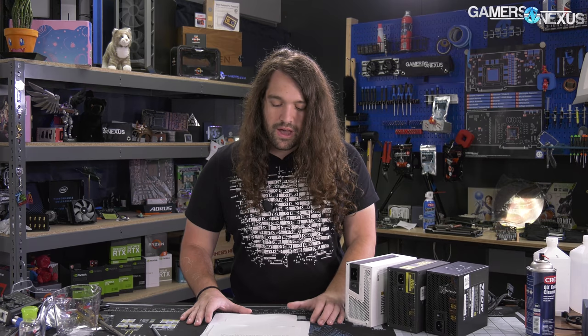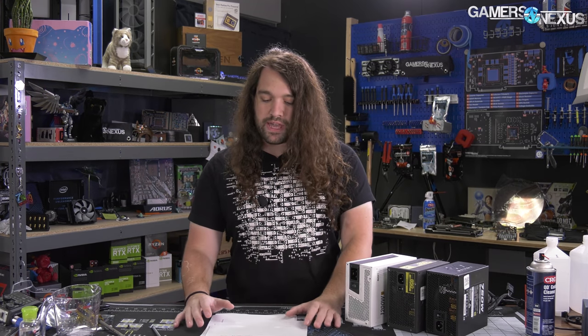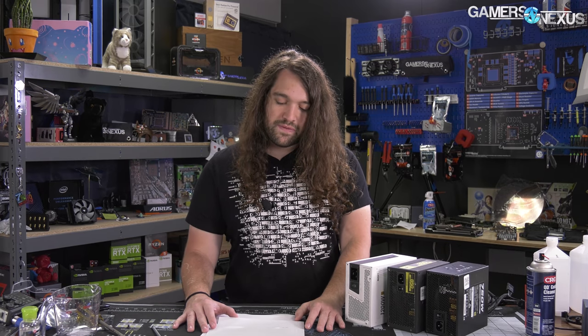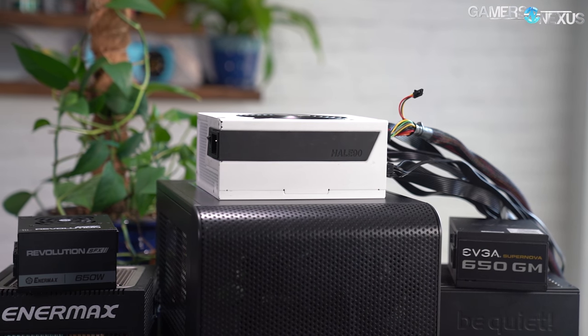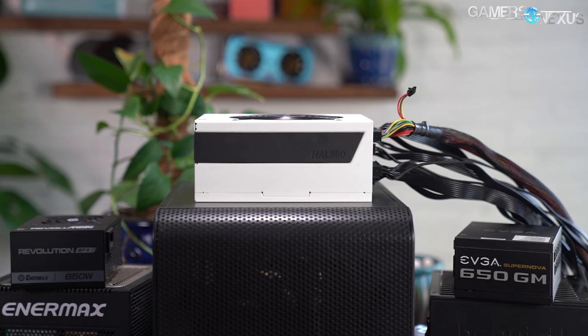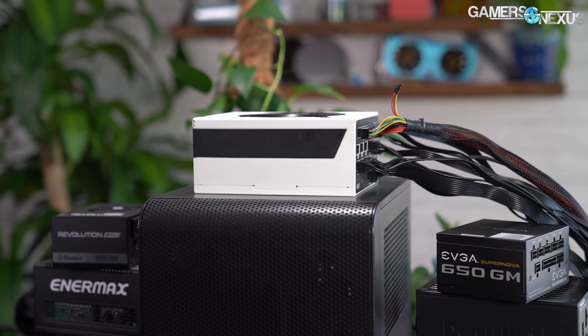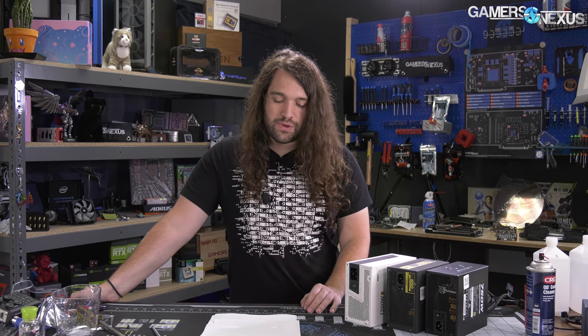The factory we spoke to isn't even rushing to start selling ATX 12V0 power supplies. Intel has confirmed they continue and will continue to publish the normal ATX spec, including ATX 12V. Nobody is obligated to adopt 12V0, even OEMs—their only obligation is to meet the CEC's standards, and ATX 12V0 is one tool Intel is offering to help. Part of this is because a governmental body including the California Energy Commission doesn't really understand computers, so those bodies recruit companies like Intel to help push higher efficiency without being completely unreasonable. Intel probably has its own motives for promoting ATX 12V0, but the sky isn't falling. 12V0 isn't such a bad thing, and adoption by the DIY market, if it ever happens, will be gradual and over time.